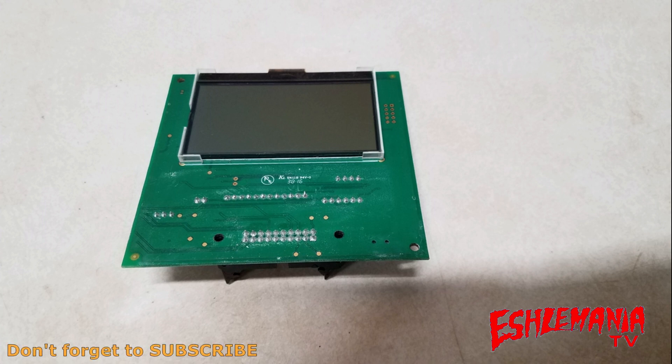HMI stands for Human Machine Interface. The HMI board gathers all the information that you enter into your Automower through the keypad. On a 500 series, it doesn't have a keypad, but the HMI board is still in there — you're still entering information through Bluetooth and through Automower Connect, and all of that goes through this board. The HMI board contains its own software, and anytime it's replaced, a dealer has to plug it in to the AutoCheck program and update the HMI software.